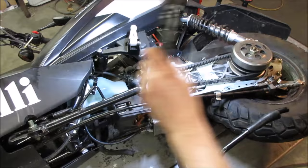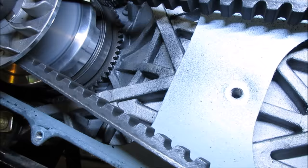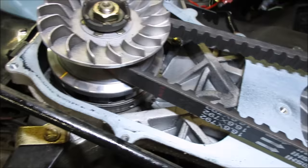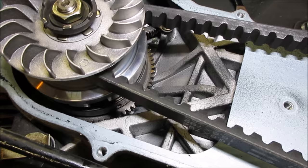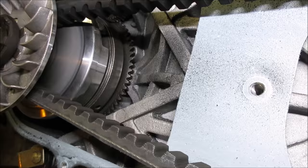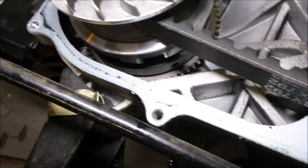Let's go see if we see any moisture spitting out around it. I don't see a thing. I don't think any of that is our issue. On an older machine, not so much a new one, the exhaust can get plugged with too much carbon coming out of it and they will plug themselves up solid. I don't see anything. I'm not gonna pull that clutch assembly out of there yet. I'm not seeing any dampness. If we saw some around there, I would definitely say that that is an issue, but I do not.